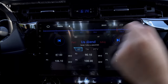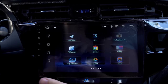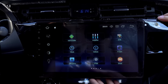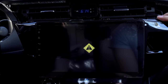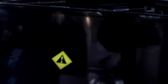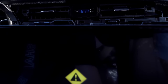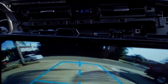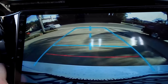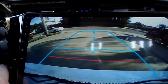Let's put the car in reverse. The car is in reverse right now but it doesn't show signal — that's the camera VIN issue. Hold this while I plug in the other camera to see which one is the reverse camera. I just swapped the camera VIN and now we can see the camera. Did you have those guide lines before? Yes. It doesn't move with the steering wheel — I was wondering if the steering wheel would affect the lines. Sometimes it does.